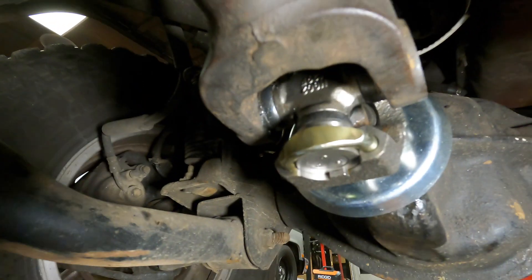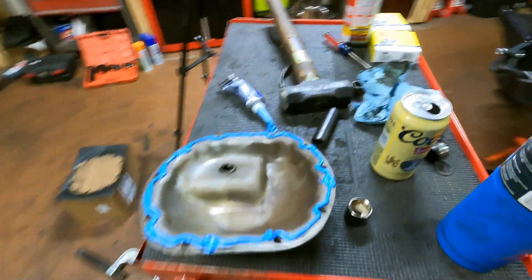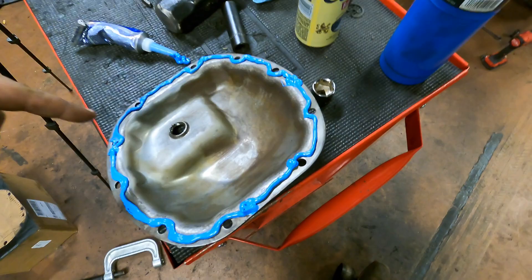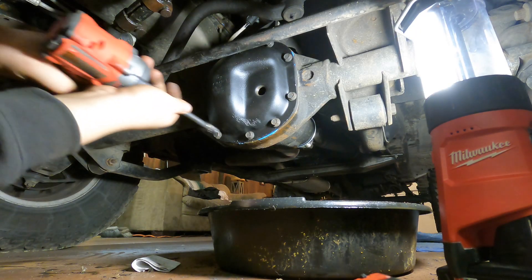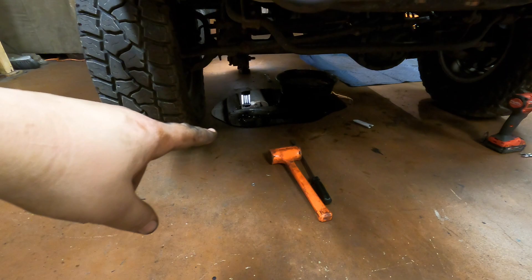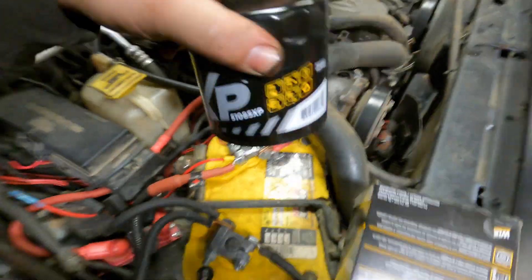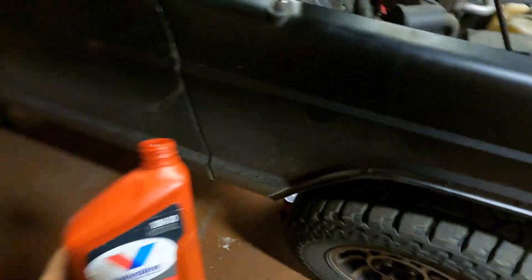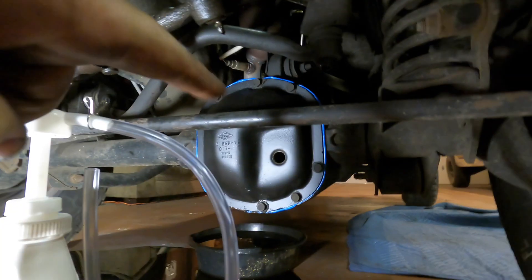Got our fancy u-bolt going in like this, then the washer and nut right here tightened up - that's going to be solid. Now that the drive shafts are hooked up, all we've got left is putting on the diff cover. It's all painted and I've got some gasket sealer around the outside. Not going to snug them all the way until the gasket sets a little bit. In the meantime, doing the oil change - got the old oil filter off. Hand tight on the oil filters. Got her plugged underneath and added six quarts. Got her filled with oil and the diff cover tight.